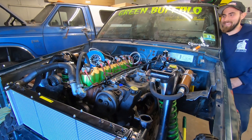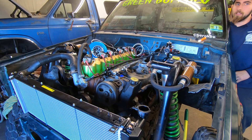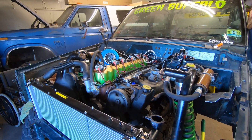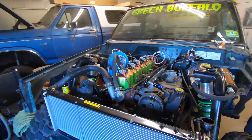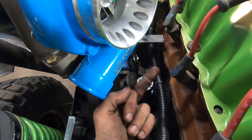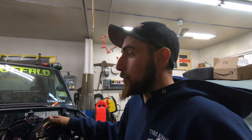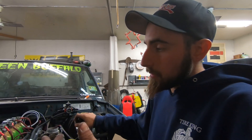We're making spark — tried it again — but something's not right. We tried cranking it and I think our timing is terribly off. As you can see, our starter works, our ignition works, we're getting fuel pressure, and we're getting some sort of spark because it's popping and banging. We tried cranking it repeatedly but our theory is that there's a problem with the timing.